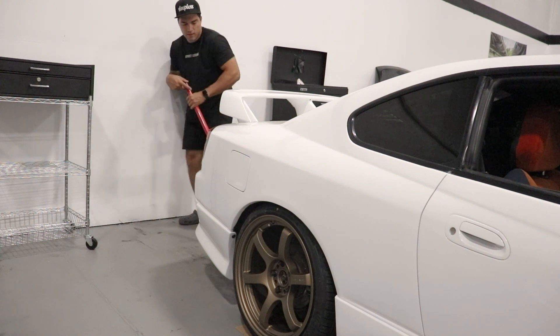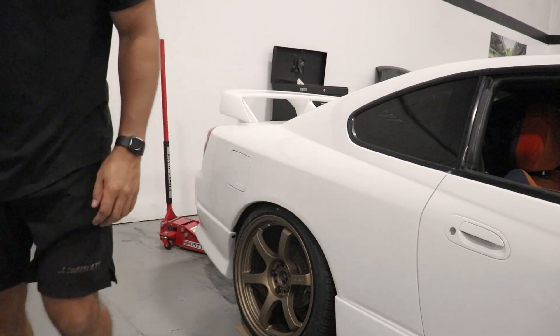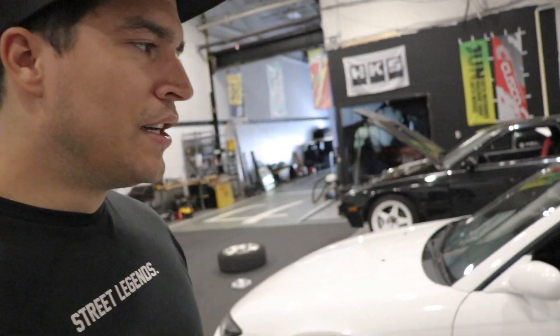We're good — but we do need to put a spacer on this bad boy actually. I heard a little crunch, so we're actually going to have to roll these quarters. The car can actually go a little bit lower, but 9.5 is pretty good. The S15 is actually the most narrow out of all the S-chassis. The S14 is definitely the biggest — I was able to fit like an 11 with just a roll and still put a pretty meaty fitment tire, I think I had 245s all around. The S15 is super narrow, even more narrow than the S13. But the 9.5 should fit good.